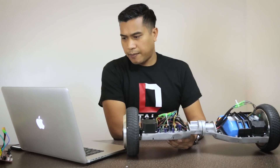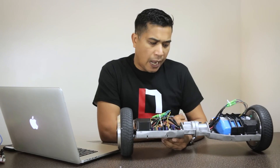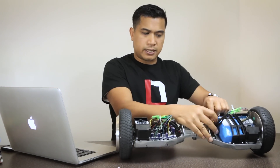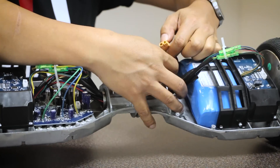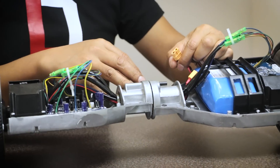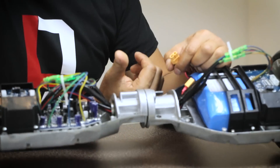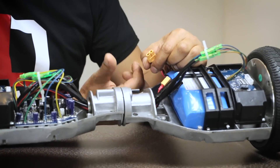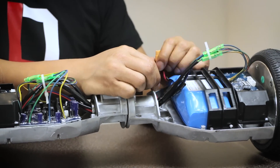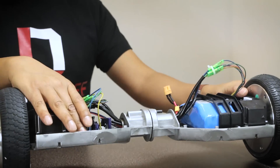I would go for the easiest fix first — try replacing the battery. One way to find out is to disengage the battery and then plug it in to see if it powers on. If it powers on and does the same thing, that would be the battery. But if you disengage the battery, plug it in, and nothing happens, it would be the logic board.